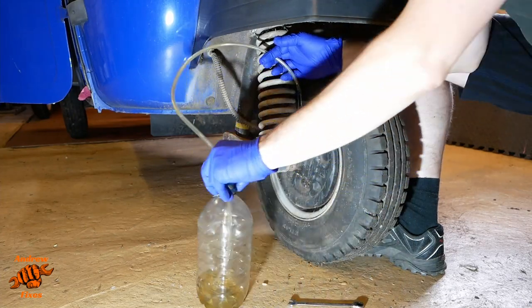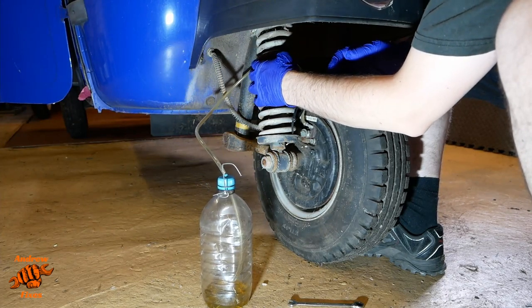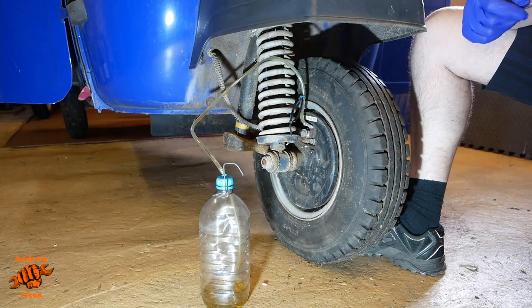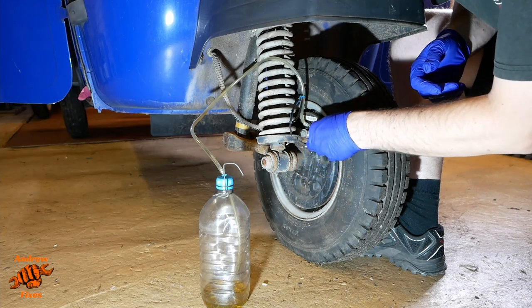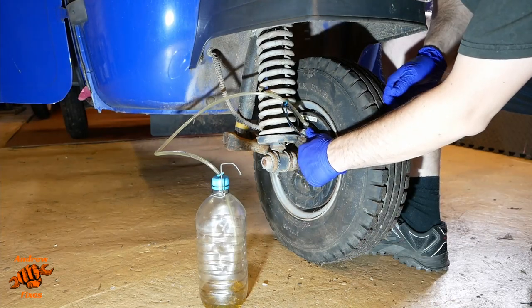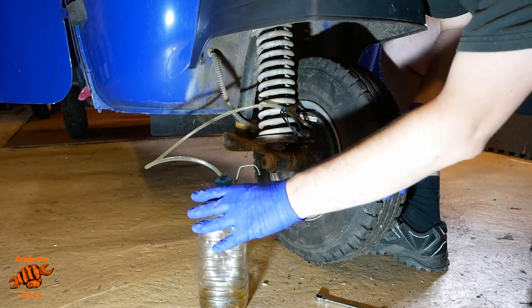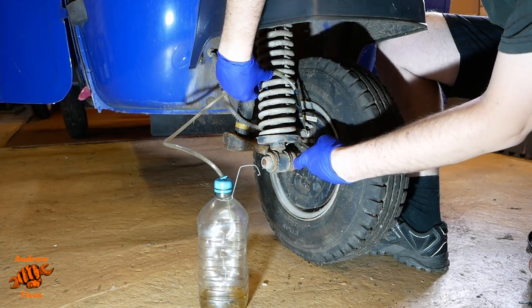And then what I usually try and do is have it going up for a bit, so there's a column of fluid rather than air should we have any backflow for any reason, although we shouldn't because we're under pressure at the other end. Now in this case, I was about to tell you they're 9mm, but they're not. It's 8. Thankfully they aren't too tight, and we open that and we just catch the bottle as it wants to fall over.